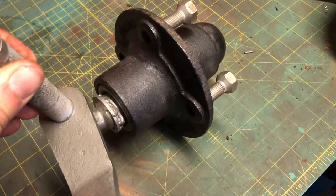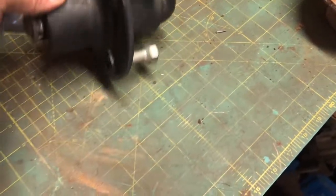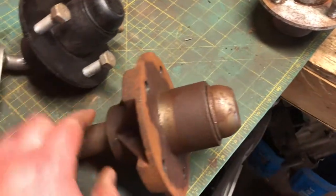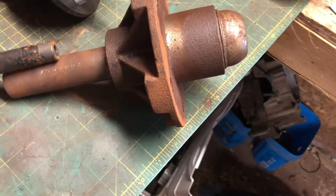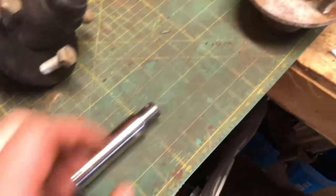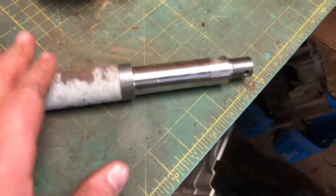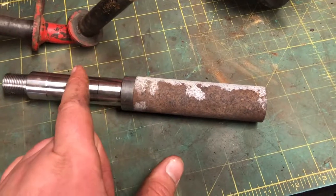As you can see on this one, it's just fitted on there like so — the four bolt hub spins freely. What we'll need is a stub axle like this. This is much larger diameter than the original. When you get this you'll want to take it apart and get the hub out of it. I've marked the length on it — you can cut this as long as you want. You can widen out these spindles a bit, but I kind of tried to keep it close.